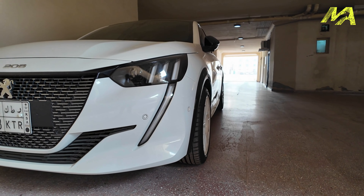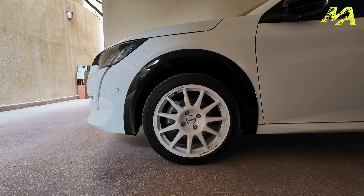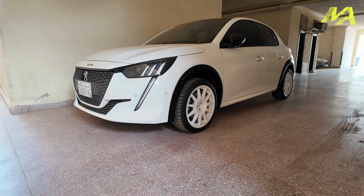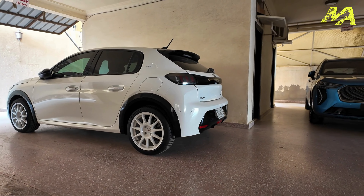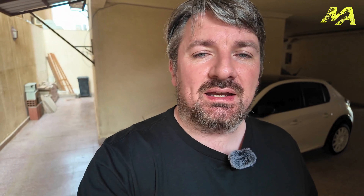It's the next day, the sun is shining — kind of windy, a bit sandstormy today. The wheels are on and oh my God, don't they look good. The fitment is spot on. They're ET16, factory is ET32 — they are quite wide on the front. I'll show you some B-roll so you can get a sense of that. I love them — they look so nice, exactly what I wanted. I had an image of what I wanted the car to look like and it looks perfect. They did check the alignment, which was out a little bit — toe was going out instead of toeing in, and the camber was slightly wrong. We corrected that. There is a little bit of adjustment where the damper bolts to the upright, so you can tweak the camber a little bit, and if we lower the car we can gain a bit more camber.